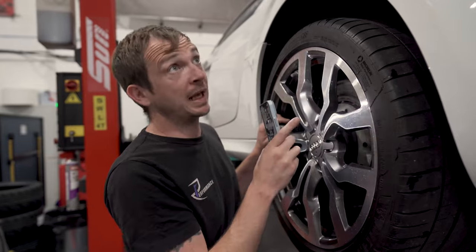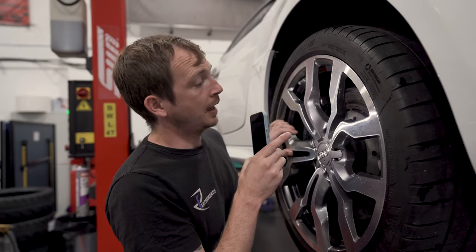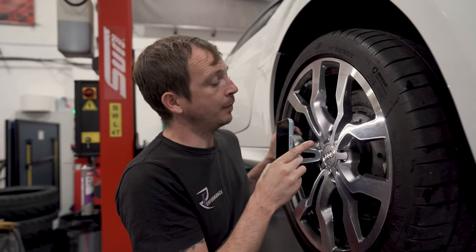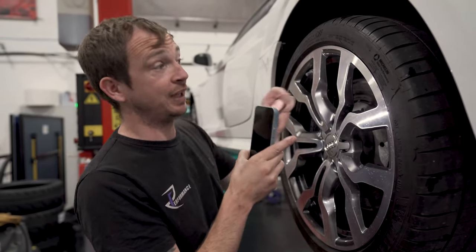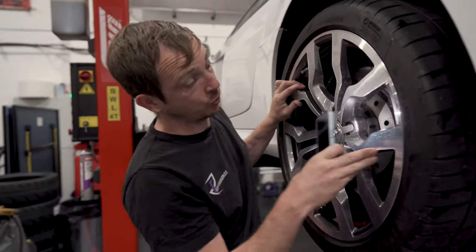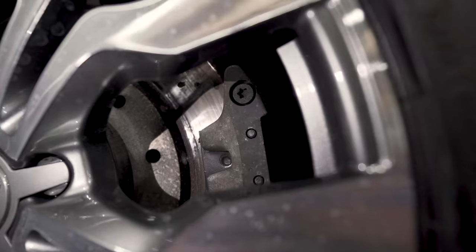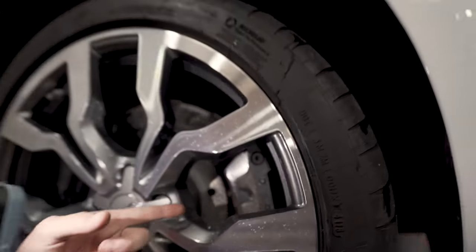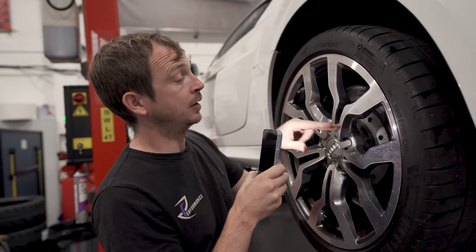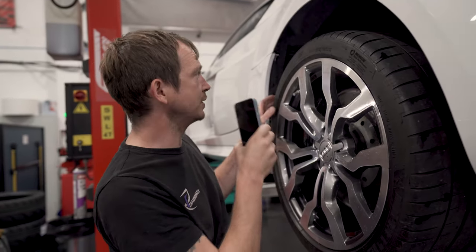We always do handbrake pads as well for a couple of reasons. When we get it in the air, I'll show you. The inside of the disc is knackered, so it always wipes out the inside pad. And also, you're then putting old pads on new discs. And the handbrake pads start to degrade on the edges. Even though they don't get used under braking, they're just a clamp there to hold it, and you can see by the sides they haven't got to do much work. But what happens is the edges degrade and start to crumble away, and we get handbrake pads in with no pad material on them. It's just the backing plate. So we will do the pins because they rot and break. We do handbrake pads, we do discs, and we'll do the proper pads as well and the sensors.